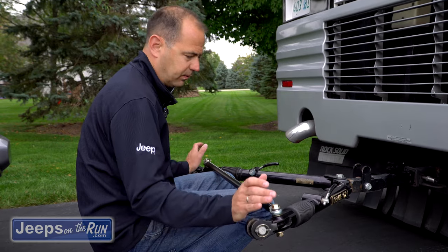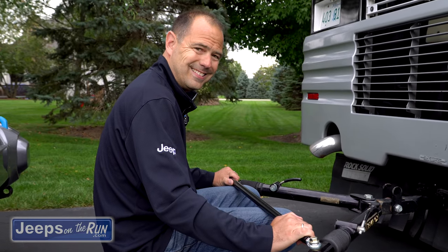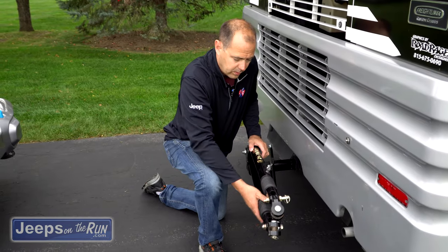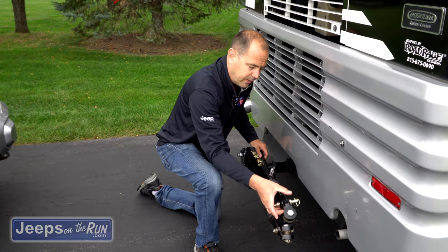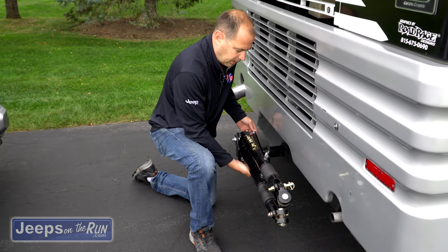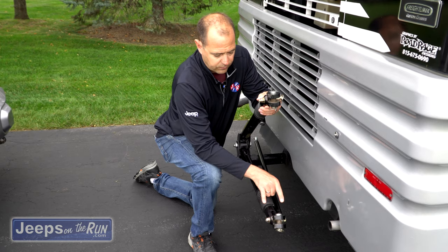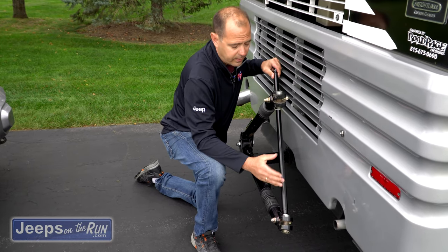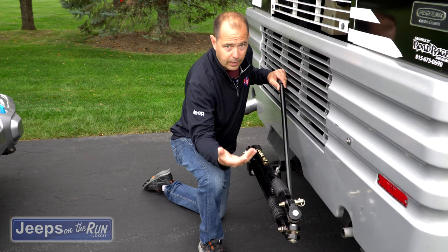This lateral bar will stop the tow loops from opening up on a heavy brake. We're gonna hook this up to the Jeep, show you how to connect and adjust it, and talk about the quick disconnect and how it stores when it's not on the vehicle. Some people store this on the RV and drive it around. The way it's set up with one side bolted on permanently and one side a quick release, it will fold up and rest on the Blue Ox — but if you're driving the RV around, it's gonna bang around and scratch things up. They do offer the option of using two quick connects so the entire bar comes out, though the downside is you'll have one more piece to store.